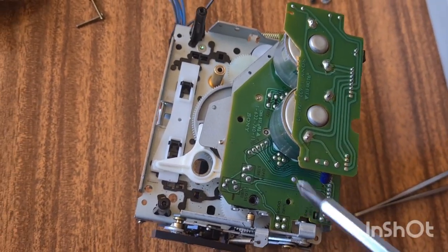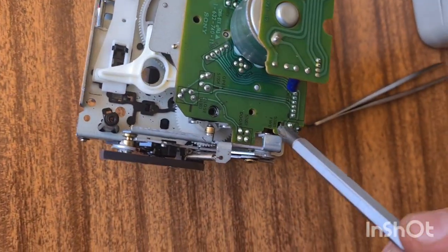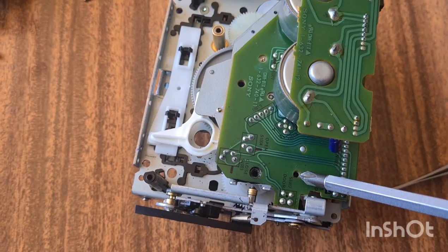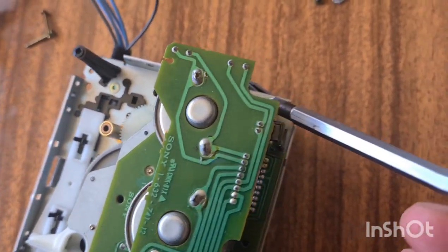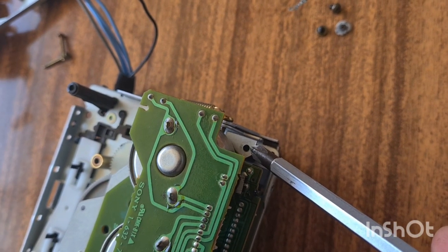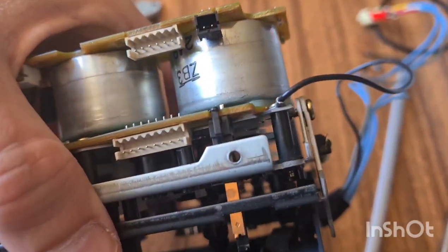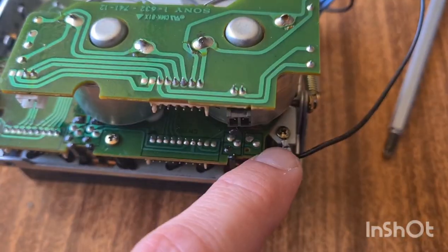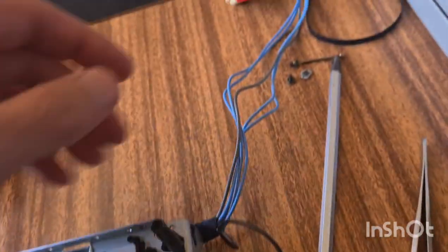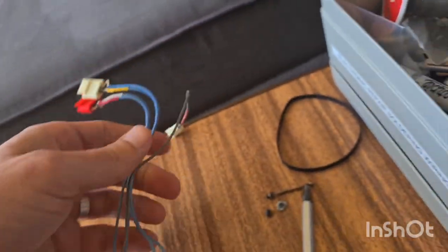Now that we've got that on, it's all lined up. You've got screws to go in here, here, and here. There's also a cheeky one over there, which is an earth lead. Alright, that's all screwed back together now. Don't forget to pop your belt onto your mode select wheel off the two black pins. Don't forget to attach your earth lead, which goes all the way down to your cables to the board inside the machine.